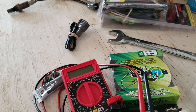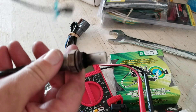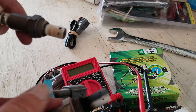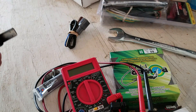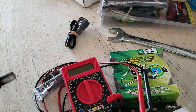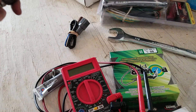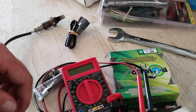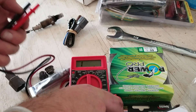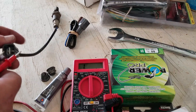To test your O2 sensors, take your sensor and look at it. Both of my O2 sensors are gummed up with white stuff, which is a good indicator that one of the sensors is bad. What you want to do is get your multimeter, set it to ohms, and test the two black wires — those are your heater element.